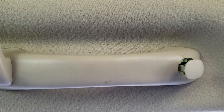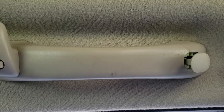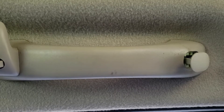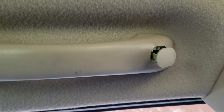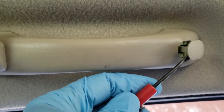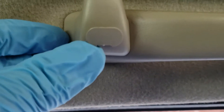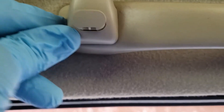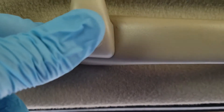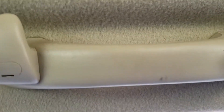Something else I had to do: I had to take the pins loose and drop this rear pull handle loose from the ceiling. Basically, all you have to do is get a screwdriver up underneath the lip and pull it out. There's a little slot on this one that you go in and pull that one out too. Once they're out, it's down. You just heard me push it back up in there and lock it.